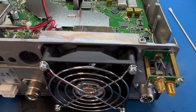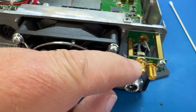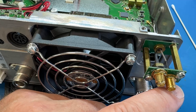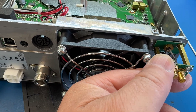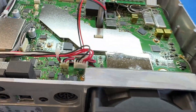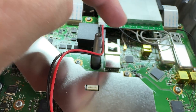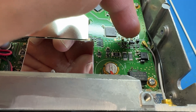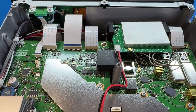The last wires are in and I've fitted this funny little adapter thing on the back. The black wire is the IF out, or the clock out, and this is the clock reference in — that's normally on the radio from factory. You can sort of see what I mean; it's a horrific little thing. I've left it not fully tightened because it's quite difficult in there and I don't want to over-tighten anything. The black wire goes across and actually goes on top — this is the reference out or the IF out. The gray wire, the one that's normally in there, installs just down here on the right-hand side if you look from the rear of the radio. This is the underside of the radio — that pretty much covers it.